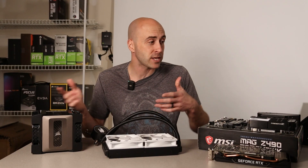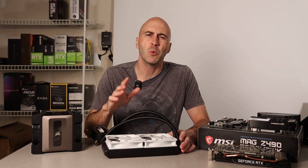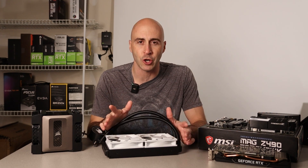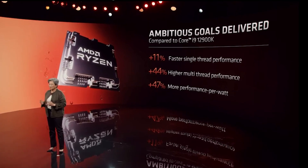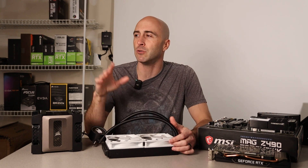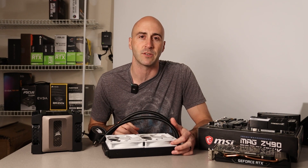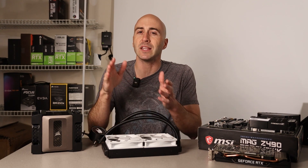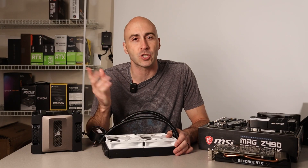If it's above 40 and you're just sitting on the desktop with nothing happening, we probably have a problem. This liquid cooler was sitting at about 50 to 60°C just at the desktop with no background tasks running. If your ambient air temperature is higher, you'll see a higher starting temperature. Under gaming, you don't want to see over 80 degrees Celsius with most CPUs. Ryzen 7000 CPUs are known to run hotter — AMD says they'll hit 95°C and hold there with no detrimental result. Any other CPUs — Intel 10th or 12th gen, Ryzen 5000 or below — should run lower than 80°C even under load. My friend's PC started fine but quickly increased in temperature under load — the cooler just couldn't keep up.